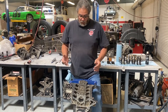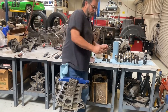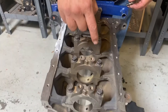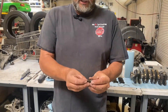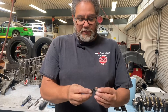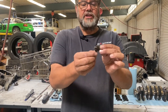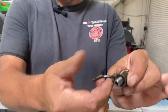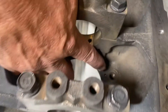One of the first things I did is install these little oil squirters right here. They go down inside the block. On the early models there's a copper washer that goes on each side of this banjo, but on this NB it doesn't come with copper washers. So the way it goes together is I take this hollow bolt, it goes through the little injector like that, and I have to make sure this little pin lines up with the hole.